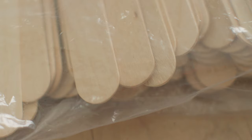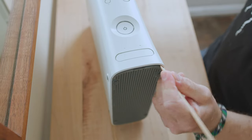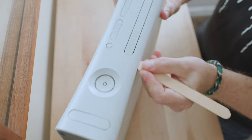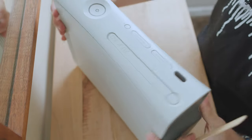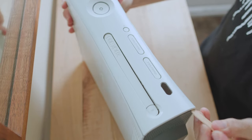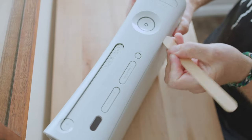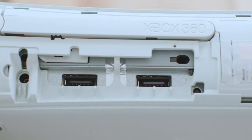I like to use tongue depressors — I've got a whole bag of them, and I'll put a link in the description below. There's a perfect hole right at the foot of the faceplate to insert a tongue depressor. I put it in there and just start sliding it all the way around — turn the corner, go up the side, go around the back, come down the other side. Boom, off pops the faceplate. You can stick your fingernails under there or use a jeweler's screwdriver if you're careful. Any way you choose, the faceplate just pops off.